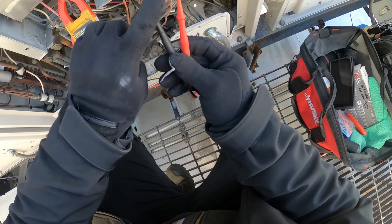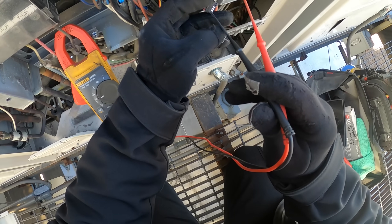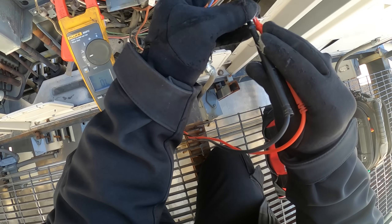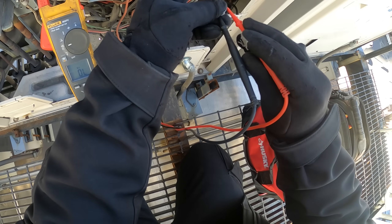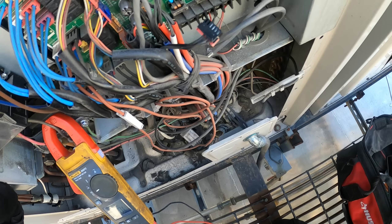I believe it is these two on the edge — and look at that: 22.6 kΩ. We were supposed to read about 22.2 kΩ, and give or take we're close to that temperature. Now the next one — 22.2 kΩ. That's the middle one, and that would be our SCN.